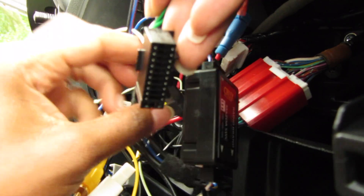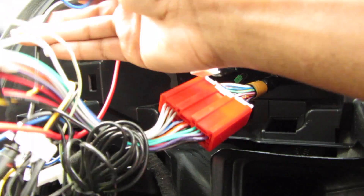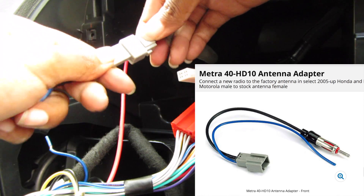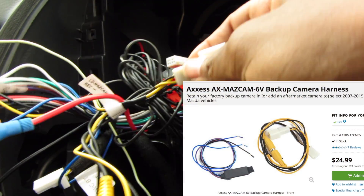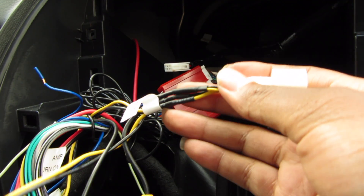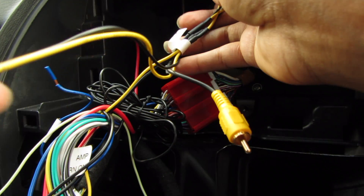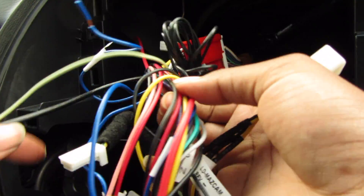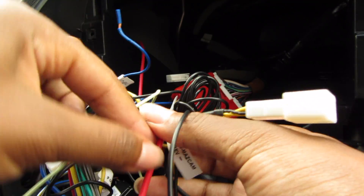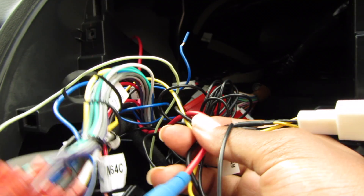This is what plugs into the unit. I'm not sure what this one was for. This one connects to this one — this is my connection for the rearview camera, and this is the connection for the mic. The rearview camera took me a minute; I have another clip to show. I had to connect this red wire going up through here, and it goes back to connect to the wire that is the rearview light.